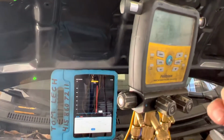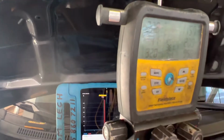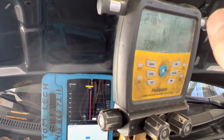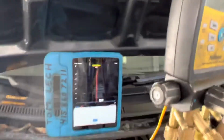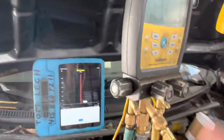Well, actually, I should have videotaped the LG heat pump the other day. I didn't get to take video, but the superheat when the unit was running was 0.4 superheat on a residential heat pump. That was a variable displacement.